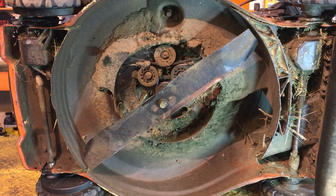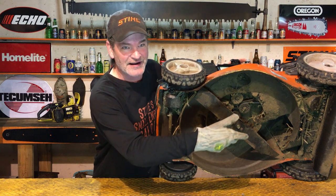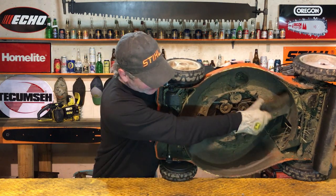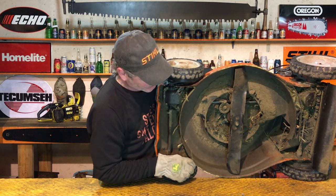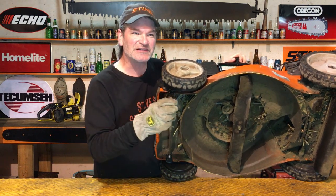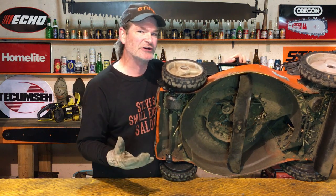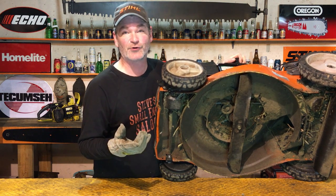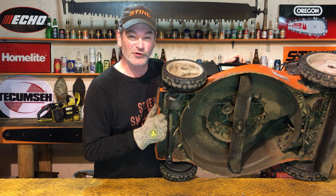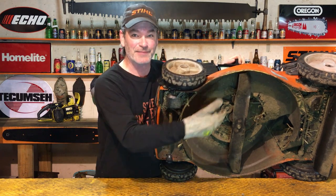You guys are gonna find sometimes that you don't actually have that blade bouncing backwards like that. You might find that it comes to kind of a squishy stop where you spin it and it doesn't bounce backwards, it just goes and stops. It doesn't keep going around and around. If it stops but doesn't bounce backwards, you got some compression there, but it's not really good compression. It may or may not be enough compression for your engine to run. It's what I said at the beginning of the video, kind of mediocre compression. There is some there. Could be something wrong with your engine too, if it just comes to a dead stop but doesn't bounce backwards.